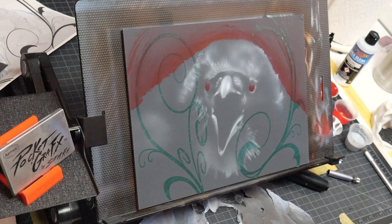And then from Coast Airbrush, you can get, I think it's Sharpline, they call it, or a general formulation. There's a lot of masking. The only one I don't ever recommend for solvent is Oracal. Oracal masks, the white one especially, the clear gray works okay, but the white and their yellow, if you get that with solvent clear that's still outgassing, like you cleared the bike the day before, put the mask on it, it'll suck the glue right off it in most cases.